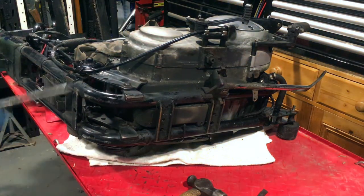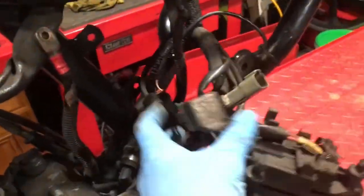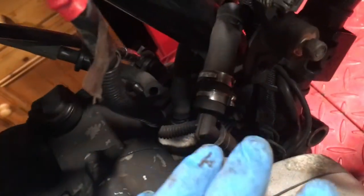It'll probably have to be drifted out from the top. Let's see what we can do to strip the electrics out and remove the motor. The core of the bike's electronics and electrics is here under the seat, where all the fuses and relays live. There's a main cable that comes up to the front — primary for the headlights and instruments. There are a few other wires: this one goes down and under where all the sensors live — ignition, oil pressure and so forth — they all go down and under on the other side of the bike.